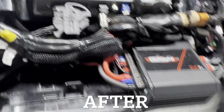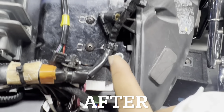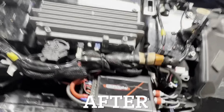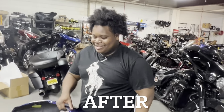1200.4 under the radio, 400.4 on the headlight, DSP tucked in the speaker pod, DSP bolted down — a 300% improvement, I'd say. Sound deadener on the pods. Good job, Josh.